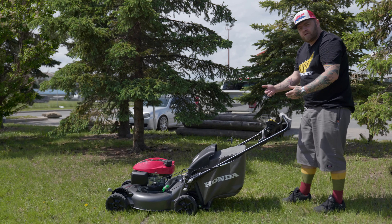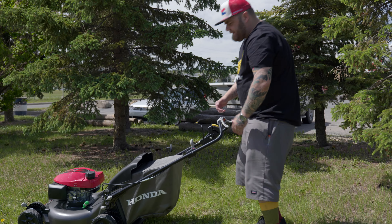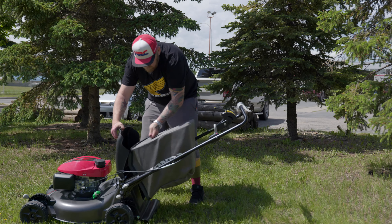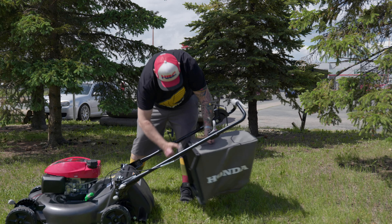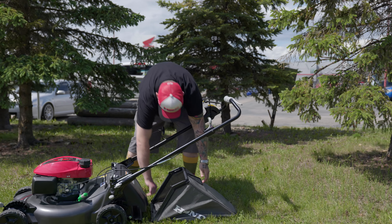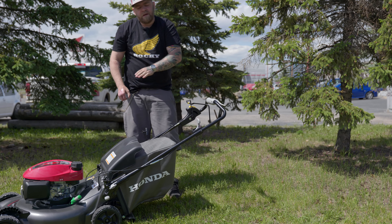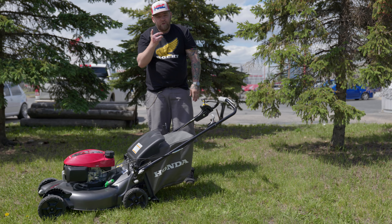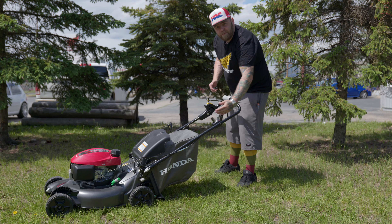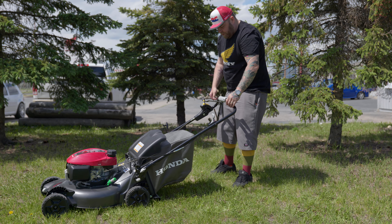When you're ready to change your bag, just throttle down to turtle speed. You can open it up — the motor is still running but remember your blade is off. Take off the bag, dump your grass, then when you're done, lift the back up, attach the bag, and off you go. Always remember the blade is disengaged, but still don't put your hands near a running blade.